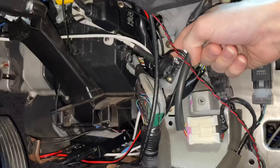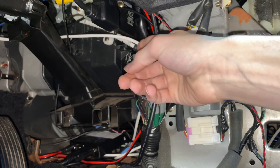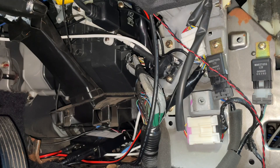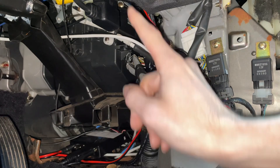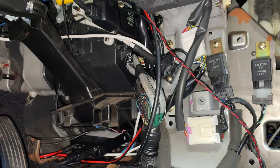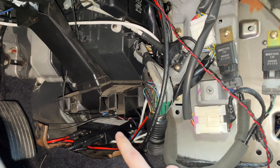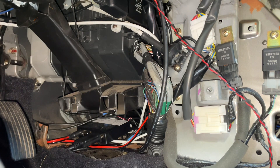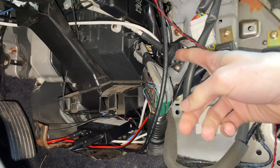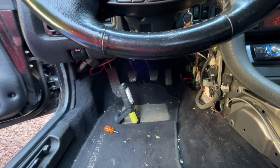Now that I have everything plugged in and set up, I want to show you my final rig. I mounted the boost pressure sensor in the cabin on this screw right here, angled up slightly towards the firewall — it fits beautifully under the carpet. I have my OBD2 cord running along the main harness up into the OBD2 port, and my LCDBC brain mounted down here, sitting behind the carpet as well. This is a really cool spot for the boost pressure sensor — well concealed and relatively easy to access if it ever goes bad.